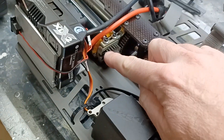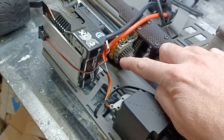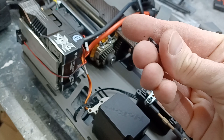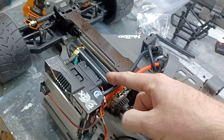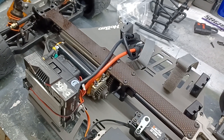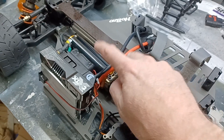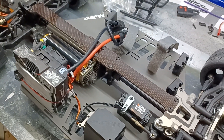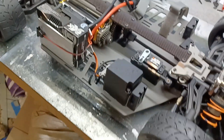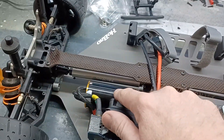The motor mount — you can't see it very well with my spur in here — it's made for M3 screws. We're talking about these little guys, so you're going to have two tiny little screws holding a motor that can output 10 horsepower. I run the 8mm shaft on more powerful motors and I always use M4 mounting screws, so I had to drill out the motor mount to fit M4 screws. That's one thing if you're going to run the motor in the rear position.